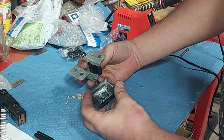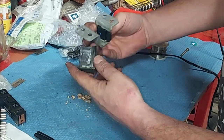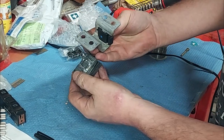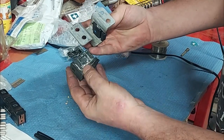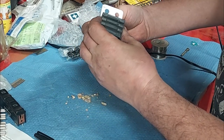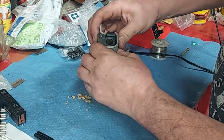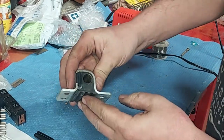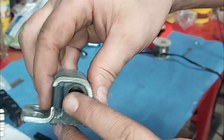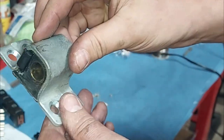This striker only goes back in one way. There's a little groove right here and a little protrusion right here — it's like a tongue and groove almost. Slide it back together and you have your piece. We'll just go screw this back on the car and the door will now shut correctly.